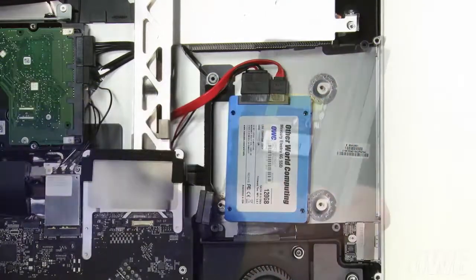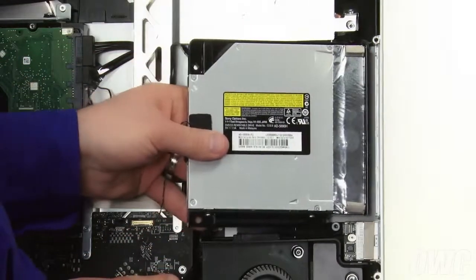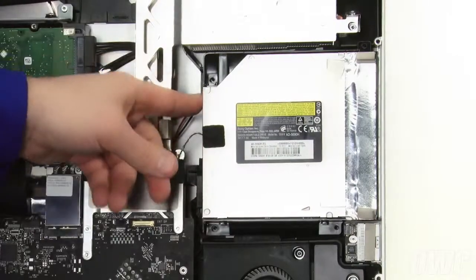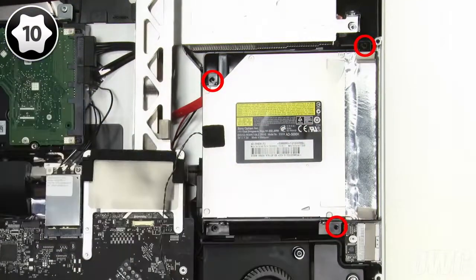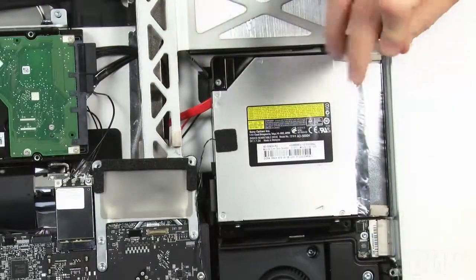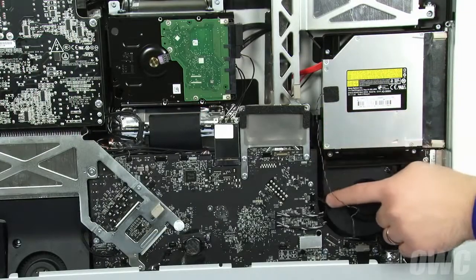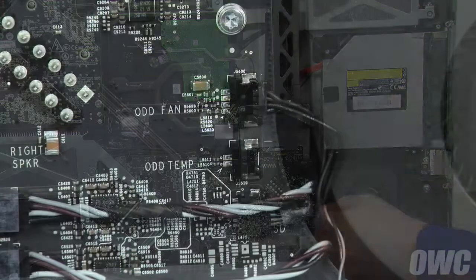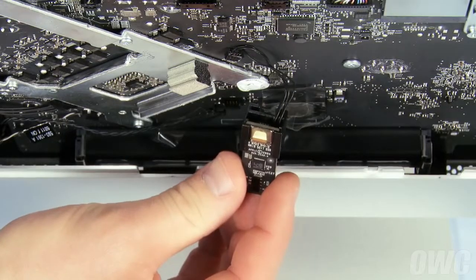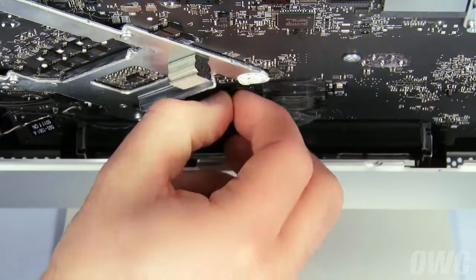There are two pins next to the optical drive slot on the case, which line up with these two holes on the optical drive. Making sure no cables are trapped underneath, slide the two holes on the drive over the two pins, attach the SATA connector, then set the drive so that it lays flat. You can then replace the four retaining screws with the longer screw going into the lower left. Route the thermal sensor cable down this channel, then plug it into the socket marked ODD Temp. Next, slide the IR sensor down over the bracket behind the Apple logo. You can then attach the cable to its socket and secure it into place with the tape you peeled back earlier.